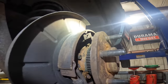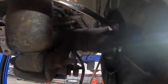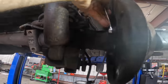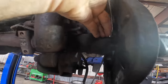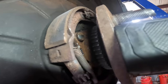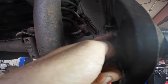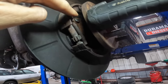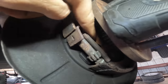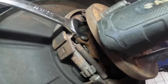We have a bit of a problem going on. While attempting to get these nuts to come loose, we can see — I'm gonna get a good bite on it here — it's stuck. We can see that these studs are turning inside of that flange and I can't get these things to back loose. The issue is those studs are splined and they're supposed to grip into that flange, but those splines have stripped out.